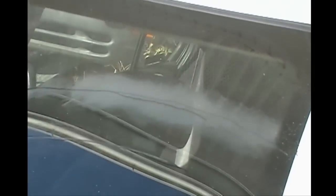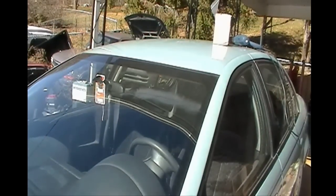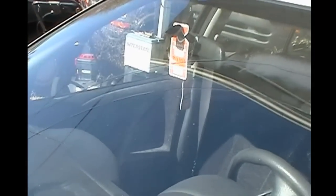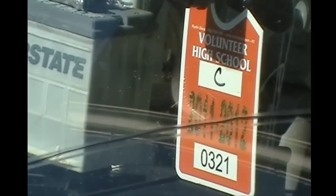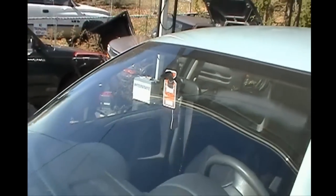Of course, I've been working on this already, but I'm going to show you what it looks like after you've been working on it for a little bit. I'll take this from step one. Don't worry about it. You can see the dry erase mark and why it makes a big difference. As soon as you hit this with water, all of this buffing basically is cleared up and you can't see it. And that's why it's very, very important to use the dry erase mark. I'm going to be going over areas that I haven't touched. You can see where the wiper blades left a mark and why the black dry erase makes that much of a difference when it comes down to doing this.